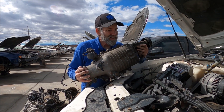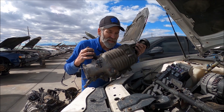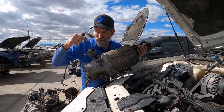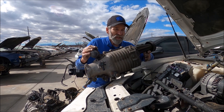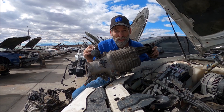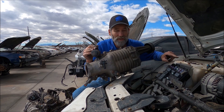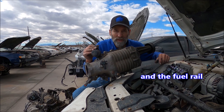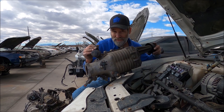Alright, there you have it — that didn't take long at all. Let's go up to the front counter and see what the damage is going to be. A lot of times in some salvage yards, they're going to charge you extra for some of these sensors, so you may want to take those off if you don't need them. And I'm sure there's a way of putting a supercharger on your 3.8 GM — you just have to get the intake. I'd get the injectors too because they are definitely going to be higher cc per minute injectors. And I imagine there's something to do with the computer as well. But if I had a GM 3.8, I'd be putting one of these bad boys on there.